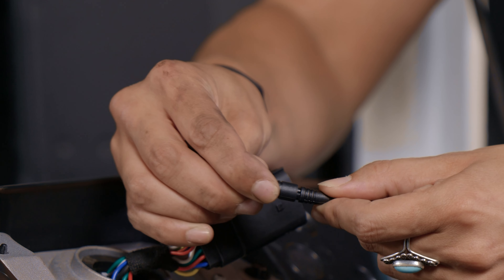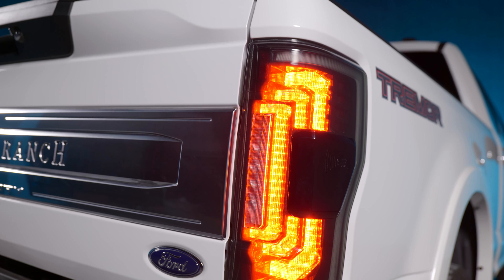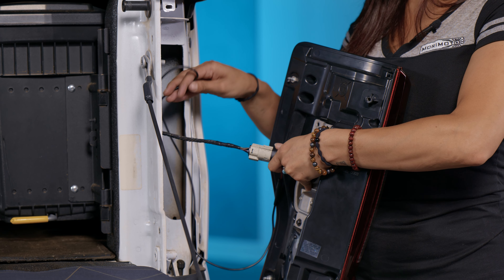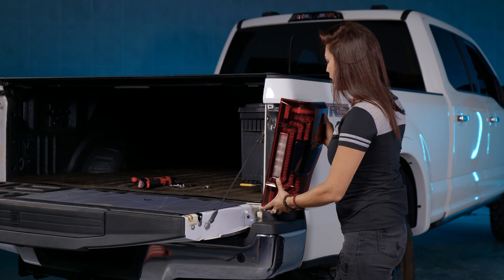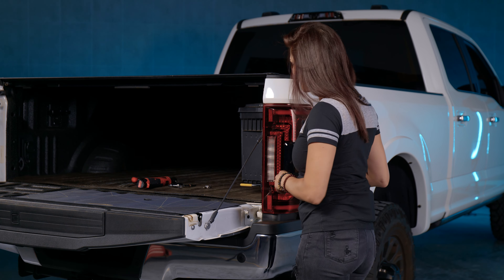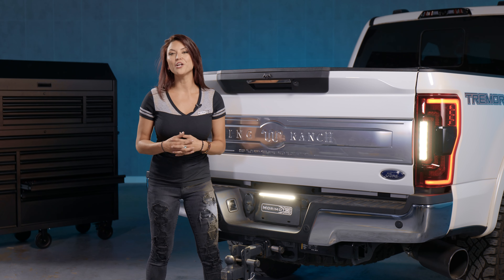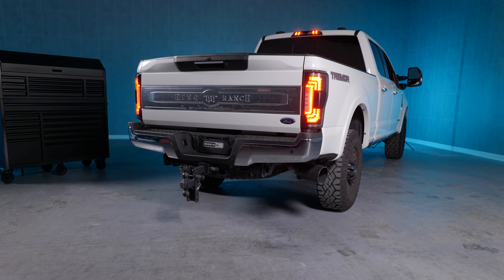Now over here with the taillight, there is a little pigtail harness right here — this is what you're going to use to connect your Boost Bar harness to your XB taillight. Go ahead and remove this little cap right here; this helps prevent water intrusion just in case you do not have this upgrade. Now just take your wire and connect it, and just like that your Boost Bar is connected to your XB taillights. Now it's time to install your taillight — go ahead and plug it into your OEM harness. Take your Boost Bar wire and slightly tuck it in there and we'll tidy it up from the bottom. Line those tabs back up and take those two screws and tighten them back down.